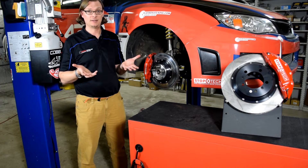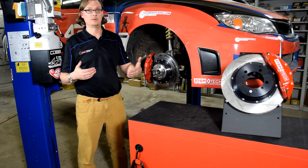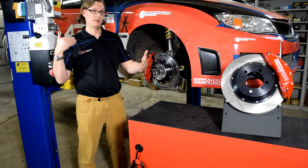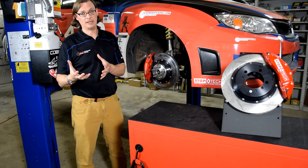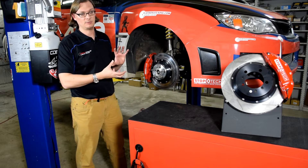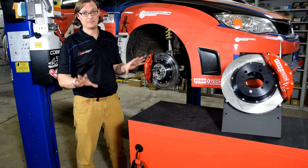The first important point to remember when upgrading your brakes is that there are actually two different criteria. One is actual stopping distance — are you trying to reduce your minimum stopping distance from a given speed? If you do an emergency stop, jam on the brakes, get into ABS, and come to a stop, are you trying to shorten that distance? The other aspect is whether you can achieve that minimum stopping distance over and over again consistently before putting enough heat into the braking system where it becomes compromised. It turns out those are two different aspects of performance.